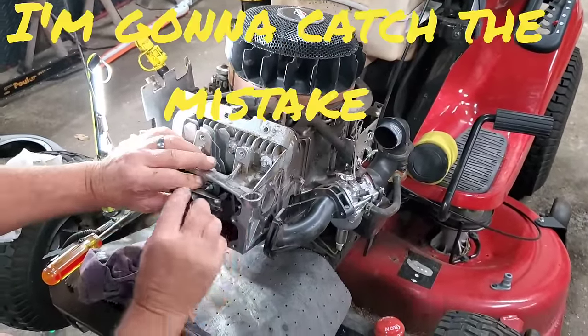And 8/1000ths. Now, they say 8/1000ths, I go a little bit tight. I have been known, on an older worn engine, to set them both at 4. Tightening or locking up, we got a good drag. And all you'll do is spin it over one more time. And 4/1000ths, nice little drag. Spin it over, intake is open. Exhaust, nice little drag, and it's a little bit tight, which is what I want.